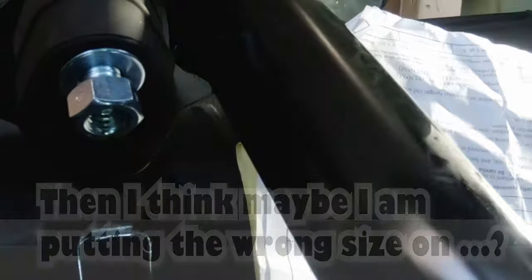Well, one thing you can do is take all your nuts and washers out and just assemble them to make sure not only do you have everything, but you know which. When you have things like this, where there's all kinds of different sizes, this is only two or three sizes here, but it makes it easier to figure out what goes where.